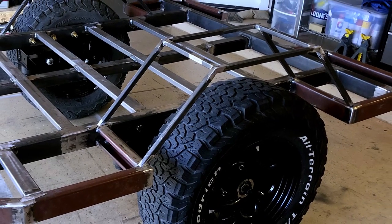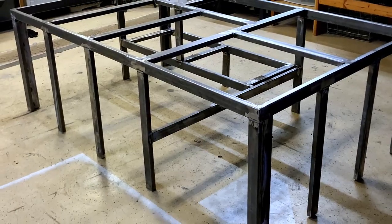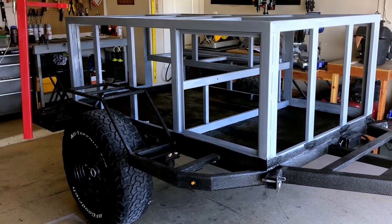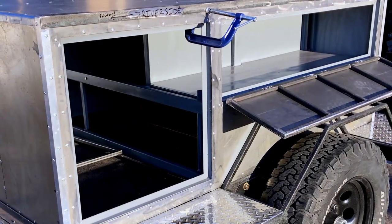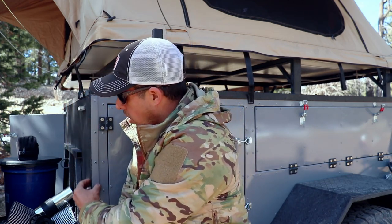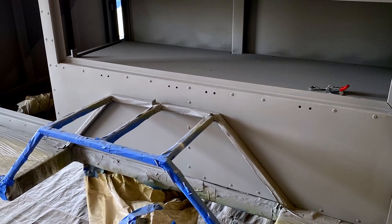Once that frame was built, I also built the fenders out and had the suspension installed. Then it was just a matter of building up. I took 1x2 square tubing and framed it out like a cage where the doors would be and where all the components would sit. Once that was there, I welded it to the frame itself, then took sheet metal and lined the whole thing, cut it out, and riveted it onto the cage. I'd definitely recommend a hydraulic rivet gun for that because there are hundreds and hundreds of rivets. Once I had it all framed out and sealed up, I took aluminum angle iron, siliconed it, and put it where all the joints would be. Then it was ready for paint — primed it, painted it, and I was pretty much set.